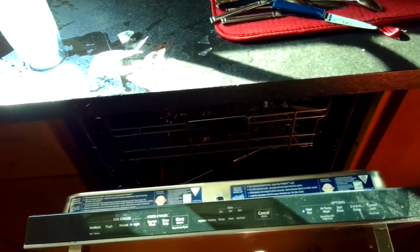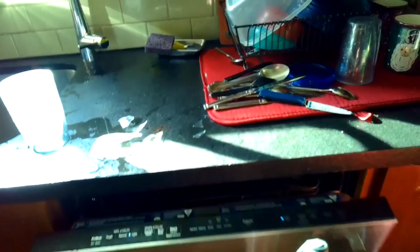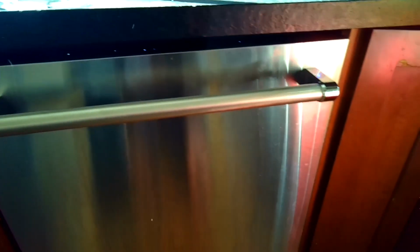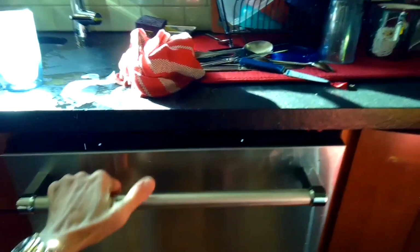So open it up. Get it set for drain. Make sure this thing can spin. Oh, we'll get a little water in there first, and then set it for drain and see how it does. So it sounds good. I can hear it draining. Water's moving. And that's all it was, is that little piece of glass had blocked it.